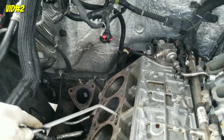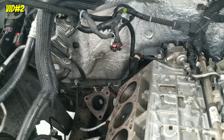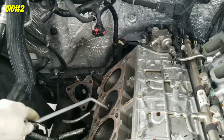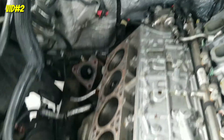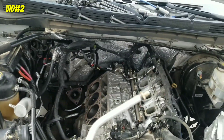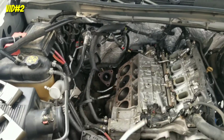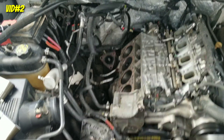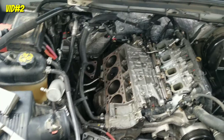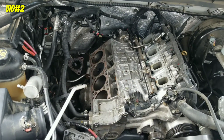I'm good to go. Next step: I'm gonna clean up the cylinders. I'm gonna drop in the head gasket, bolt the head down. Torque spec is gonna be 22 pounds, 90 degrees, and 70 degrees. Let me go ahead and clean, install the head gasket, drop in the head, and torque it down.